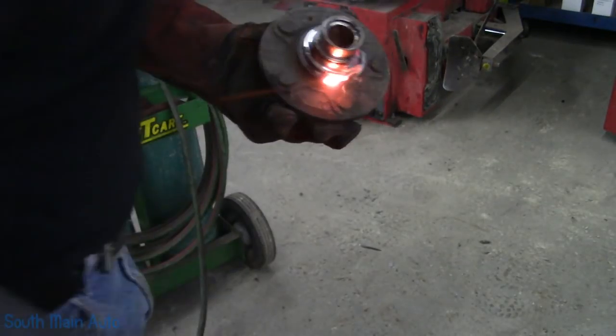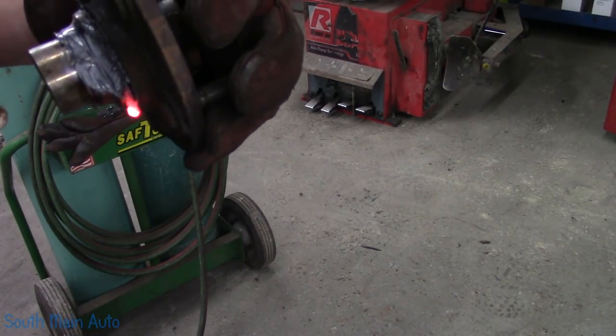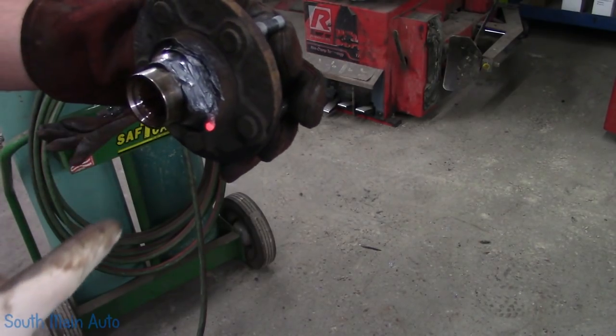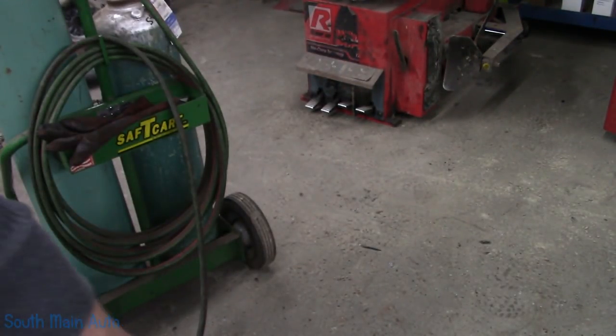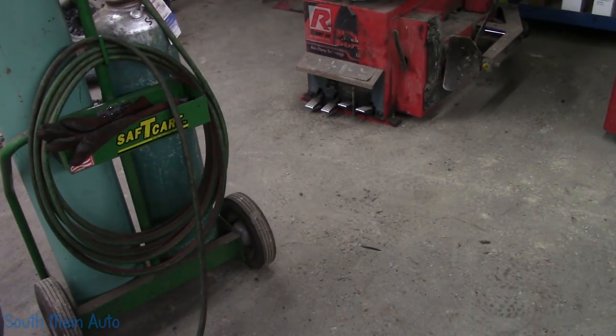Quick, won't hit the shaft. I don't know what you guys could see while I was doing it, but you blaze across it. You just nick the top off, and that's going to relieve enough tension. We get behind there with the air hammer, and usually you just give them a little toot. Make sure you put on your safety squints, because, like I said, they are glass hard. They will get you, usually right in the lookers too.